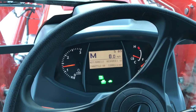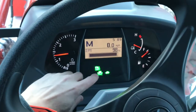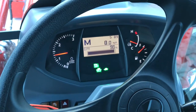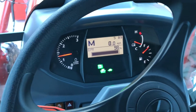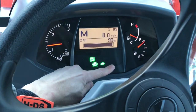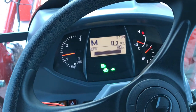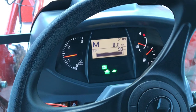At some point the regen light down here on the dash should come on at 100%, and then it should go into regen mode. Likely because I don't have the RPMs high, it's going to start flashing an RPM indicator over here, which should indicate that I need to increase the throttle, at which point the light should go off and the regen should start.